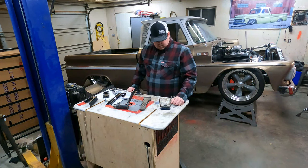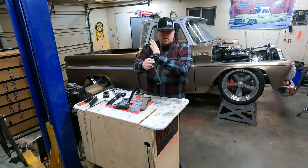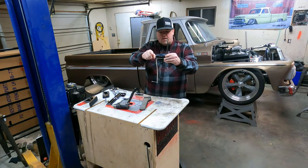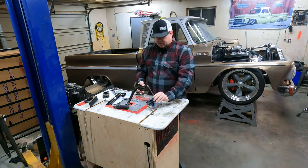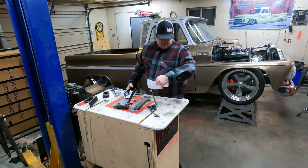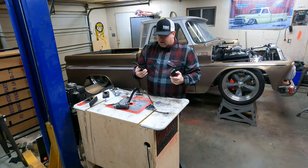I needed a nice gas pedal or original and a bigger brake pedal. I ended up with a square body mount — square body Chevy — the mount has the offset. I've actually taken the top off and I'm going to re-weld a piece so it'll operate off the cable, all inside the firewall. I ran across these Billet Specialties pedals — they're for '55 through '57 Chevy, '58 through '64 like Impala, Biscayne, and '63 through '67 Nova. Here's the Nova gas pedal and here's the Billet Special ones — quite a bit different, really nice pieces.